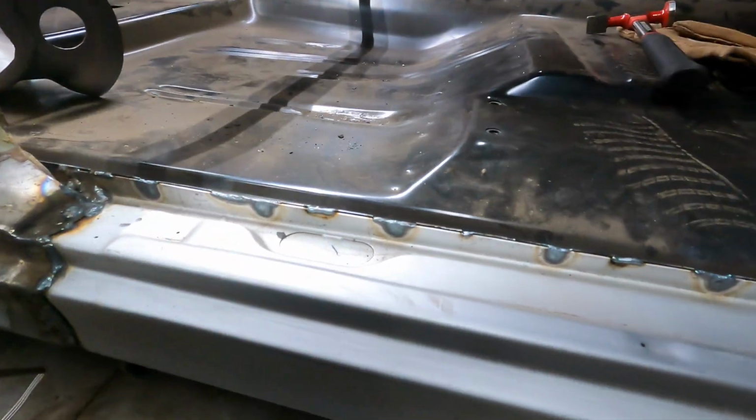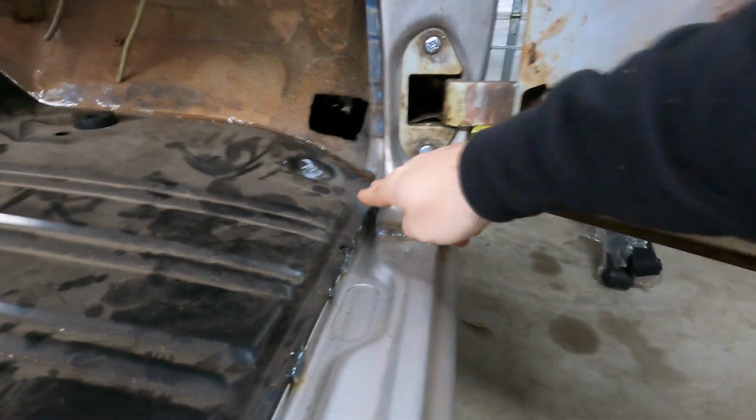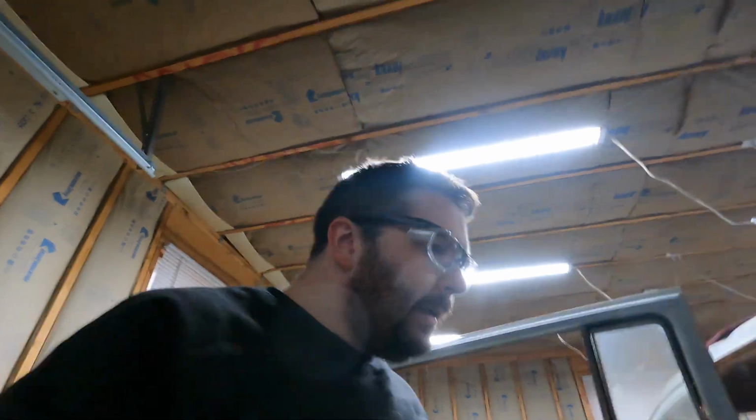So you can also do it with the wire feed weld. I've said it before, like when I did this lower pillar weld portion, I like the control of a TIG welder, and that's what I did for a living for 5 years, essentially, was TIG weld. So I feel most comfortable with it. I do wire feed weld. This is wire welded, that's TIG welded. This front section was TIG welded, that was wire welded. I kind of alternate back and forth, but the TIG doesn't throw as much smoke, and now that I've got everything sealed up, I no longer have the open soffits for air ventilation blowing through. I want to keep it as less smoky in here as I possibly can. TIG allows me to do that. That's why I'm doing it.